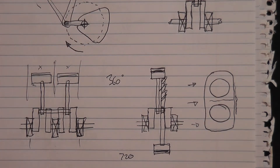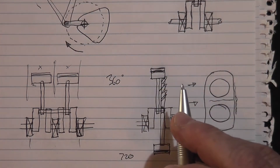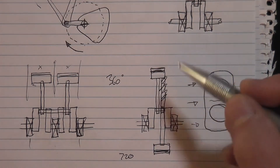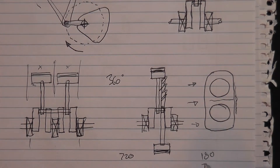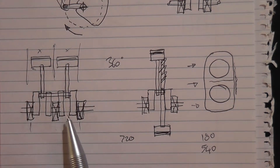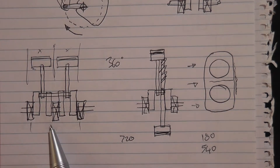The timing of the pulses however is different to the 360-degree parallel twin. Because you've swung the cylinder by 180 degrees, you end up with the timing very much like a 180-degree parallel twin, so the firing pulse will be 180 and 540. You've ended up with the same balancing problems but without the even firing pulse — instead you get the very irregular firing pulse of the 180-degree parallel twin.